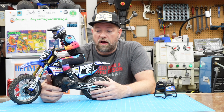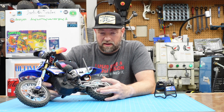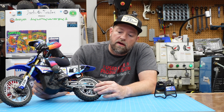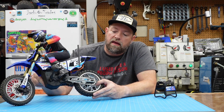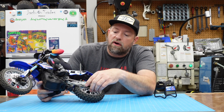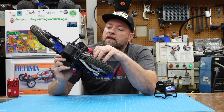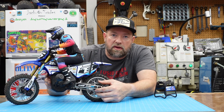I went ahead and printed a sprocket. I was going to machine one in aluminum since that will probably hold up better, but printing was quick and dirty. I went from the stock 36-tooth sprocket down to a 24-tooth — what I'd consider the extreme smallest you can get. I think 24 is probably pushing the limits because you get to the point where the chain starts to rub on the wheel hub and also on the swing arm. We're just barely clearing that swing arm, so I think we're in a sweet spot for the smallest sprocket on this bike.